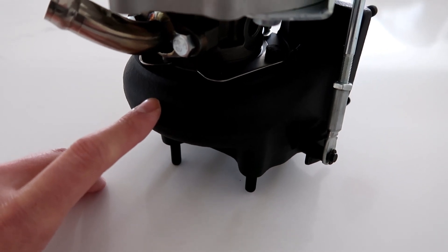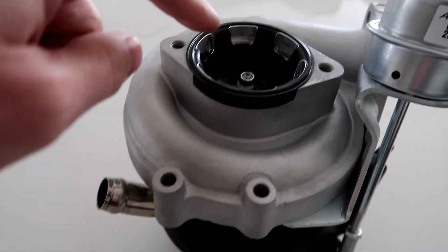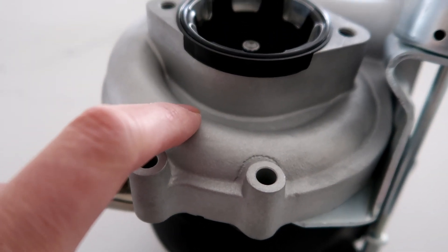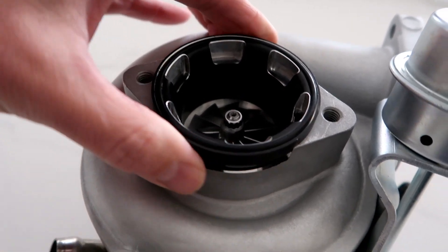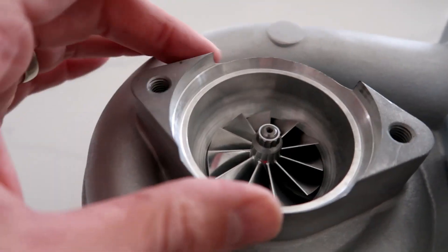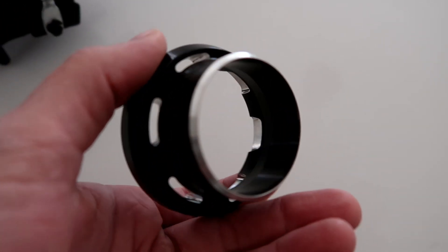So on to the 47Rs — this is information pretty much straight from Spectrum's website. The 47R uses a 47mm compressor with a two-piece billet ported shroud, which helps ensure a broad flow range. It has a ball bearing CHRA center housing and a 12 to 16 psi adjustable wastegate with a hand-ported wastegate port. On the turbine side it's a 53mm inducer with a 47mm exducer, with options for a 0.48 AR or 0.64 AR turbine housing. On the compressor side it's a 47mm inducer and 60mm exducer with options for a 0.42 or 0.6 AR compressor housing.